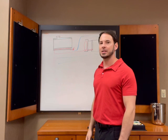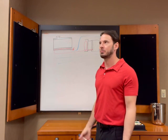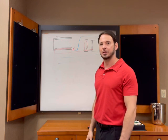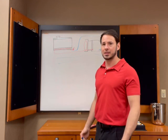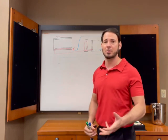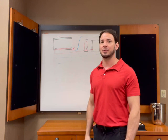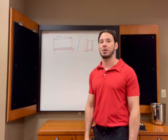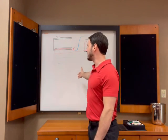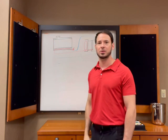You get on a really steep grade, the SVX is gonna be in fourth gear with the torque converter locked up and, like, nothing. Especially with the way the TCU works in this old car, where they're not really worried about emissions, they're worried about the car being quiet. Anybody who's driven an SVX knows what a fight it is to get the car to actually come out of fourth. Pretty sure you could be at half throttle on a hill and it's still gonna be in fourth with the torque converter locked.